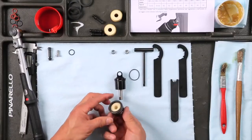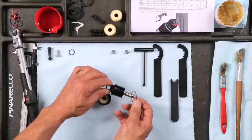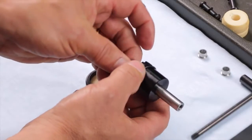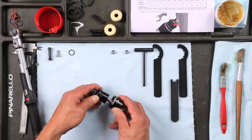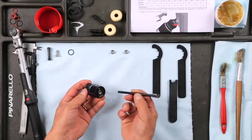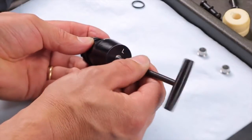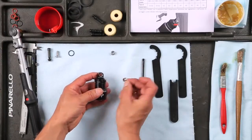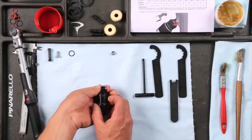Once you have scrolled up the o-ring with inner diameter 25.5 millimeters on the collar adjuster, assemble the suspension, inserting the shaft inside the hole of the elastomer. Use the T-shaped tool to align and pull it out completely. Finally, assemble the mount bushings on the top hole of the upper mount.